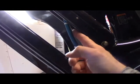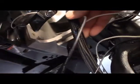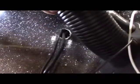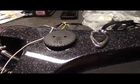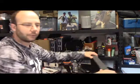Alright, so you guys could see the power cords come down. I'm following the hydraulic line. I fed them through the power pole mounting bracket and followed the hydraulic line again to here where it goes into a loom, and I cut a little slit in the loom right there so that my power wires for the light can come out. I'll follow this transducer cable in through this hole here, which all I did was take this cover off of, and from there underneath the back of the boat I will hook it into the power source for the rear light.